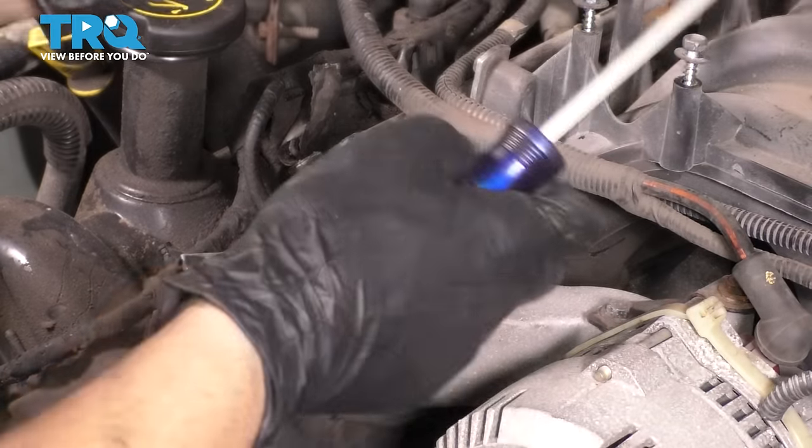You're supposed to see the spring around it seat right into place, and if you don't see it, that means it has not snapped around the retaining ring on the fuel rail. And it will pop off eventually. So make sure that you can see that spring looking retainer around it. Double check it, even triple check it if you have to. And obviously we'll check for fuel leaks when we're done. But for now, just make sure that the feed and the return lines are pressed onto the fuel rail tightly.